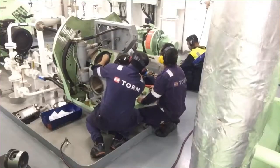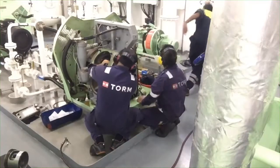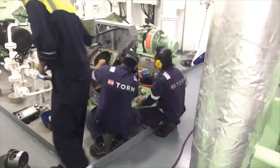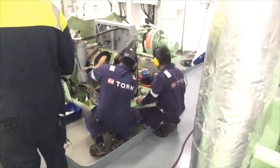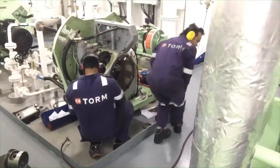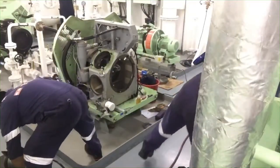So I used a little bit of hot gun to melt the thread locker inside the thread. So now when I box up, I do the same and put thread locker. So don't ignore this when you box up something like this or some other mechanical device, especially internal parts. If they have bolts, allens, or screws, you must put thread locker. This is the best way to not create further problems.